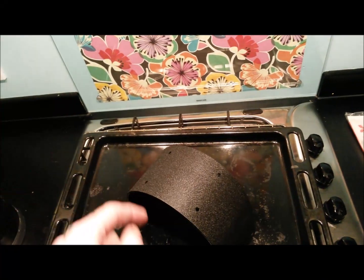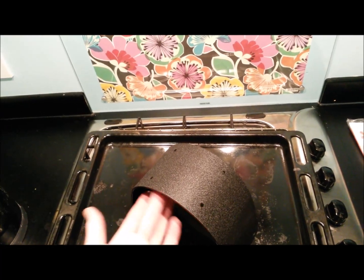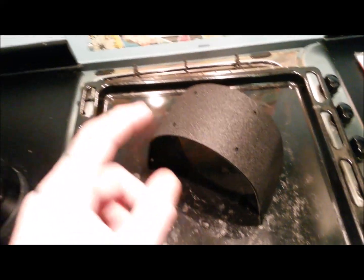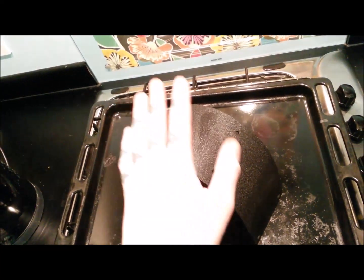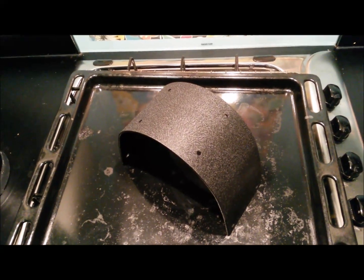I'm going to have to leave the mudguard there - I haven't tapped the holes, I'm just going to put a nut underneath since there's enough room. I'll have to grab some M6 nuts from work tomorrow, so I have to wait until the next video to show the mudguard fully installed. That's pretty much it for this video - we're going to wrap up now. Very close, almost there. Still to do: connector block for rear indicators and brake light, front mudguard, sort out the seat. Almost ready for a test ride - fingers crossed for next weekend!